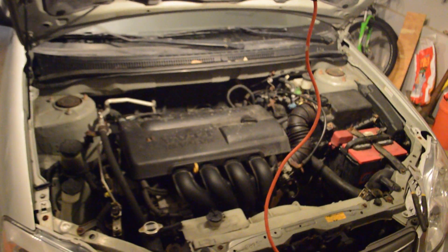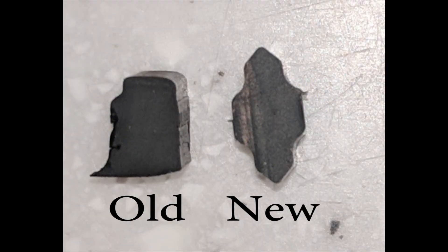It's up and running. I'll take it out for a drive and see how it looks. I compared a piece of the old and the new gasket — you can see how flat the old one is, really flattened out, while the new one has that nice profile. Hopefully the new silicone gasket maintains its shape better over time. I took the car out and ran it for maybe 20–30 minutes, but it still didn't run the test for that O2 sensor, so I don't have the answer yet about whether it really fixed the problem. I'll post the answer later to tell you whether it actually resolved the problem. I had previously spent money replacing an oxygen sensor that didn't help at all. I hope this video was useful.